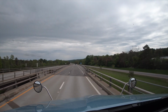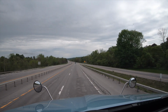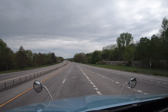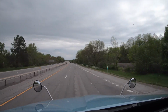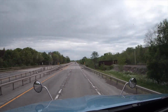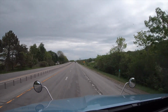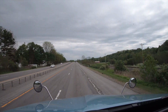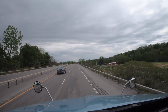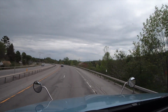See what they do is when you have a fault with the EGR or the DEF system or the SCR system, all that stuff that cleans the exhaust, it puts the truck into derate mode, which means it limits the horsepower. So I was in the first stage. I don't know how much it reduced my horsepower, but I was still able to drive at normal highway speed. I think if you keep going and you get past that 4 hours, which has never happened to me, the truck won't even go like 40 miles an hour or something like that. So it's a way to force you to get to the dealer.